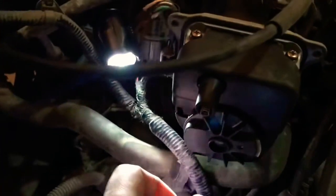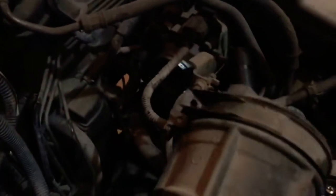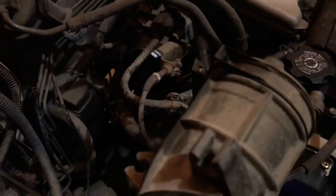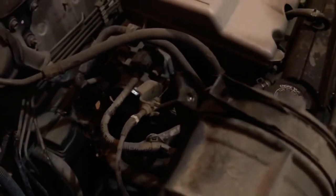Use a shorty screwdriver, or if you have to use a long one, you will need to remove the air intake inlet — there is just a quarter inch bolt up here. As you can see, I snapped mine; it was completely rusted out even though I used deep creep. I'm going to have to go to the junkyard tomorrow and replace that. Slide it out of the way.